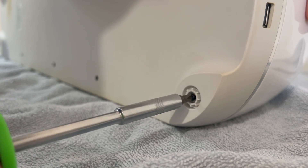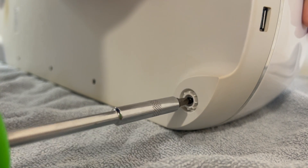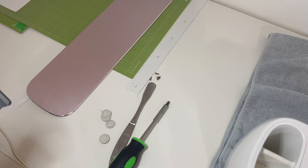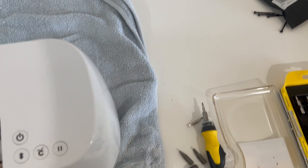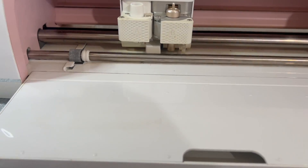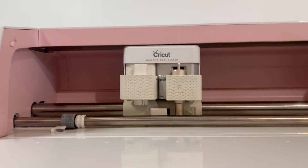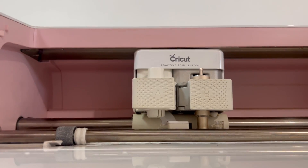Then, to take the cover off, I used the mini electric screwdriver. Next up, I turned the machine on its side to remove the little feet. Under those were more screws that had to come out. Make sure you're keeping all the screws separate and organized — there's quite a few sets along the way. The next set was a little tricky; the top inner screws were a little hard to remove, but after that part the first step was complete.